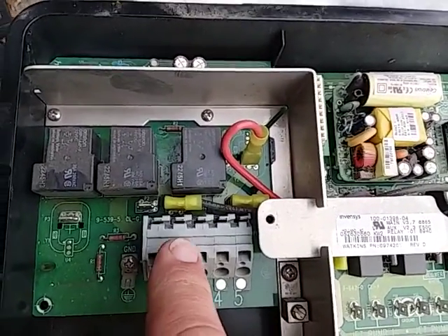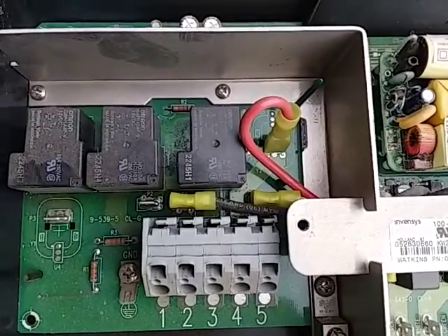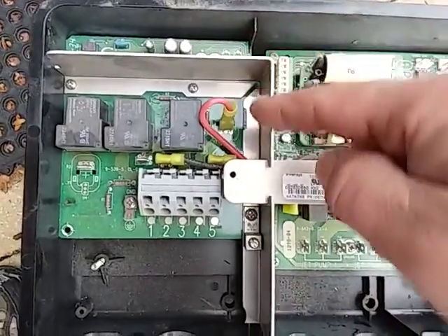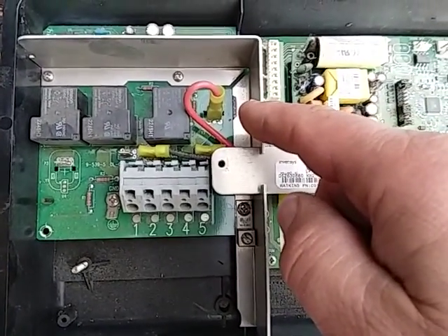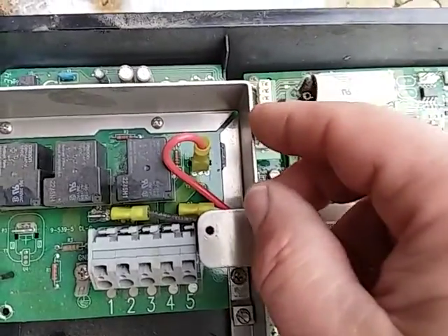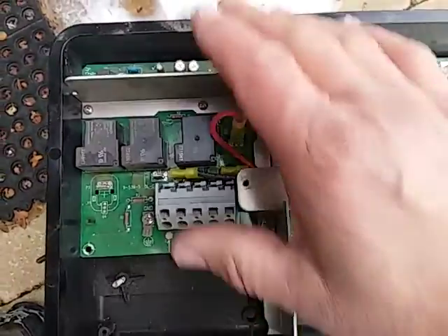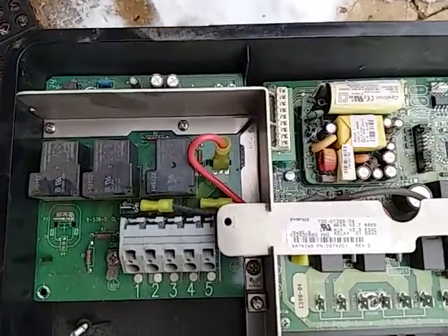They've revised this relay board about five times since the original style, so they've gotten pretty reliable. Rest assured that when you get a new one, it's going to be a much better design. The newer design has a chip on the circuit board right over here, and this metal bracket could actually touch the legs of that chip. They cover it with a piece of tape, but the install instructions don't really mention that it's a good idea to take a pair of pliers and bend that bracket up in the marked area, or put it in a vice and notch it out with a file — so when you reassemble it, you won't risk the bracket poking through the tape and touching the legs of that chip.